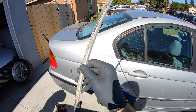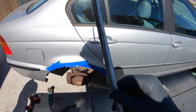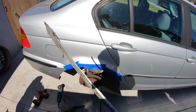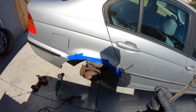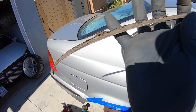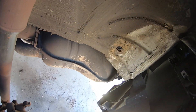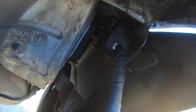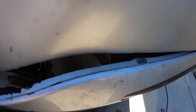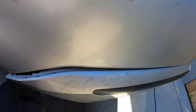Here's our inner fender. As you can see, some of it we cut a little thin, some of it we cut a little thicker. I just didn't want to cut too far out because sometimes if you think you got it, you really don't and you will be able to see it on the outside. I'm going to go cut the other side and then throw the grinder wheel on and finish it off - just keep grinding it down. None of the epoxy is actually on here. This is the main area where it rubs, so we're going to get rid of that with the grinder. There's a plastic piece right here that kind of sits under the lip of your bumper - you don't need it. So I took the nut out, cut the stud off, broke this off, but I left it back here because we're still going to put that plastic liner back in. We're going to drill a hole right back here somewhere and put a zip tie just to hold that in so it's not sticking out.